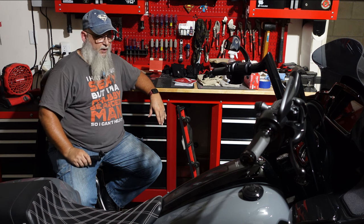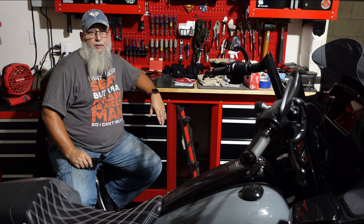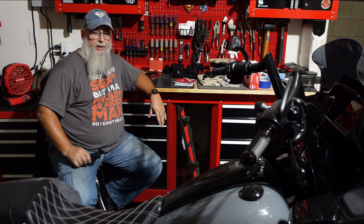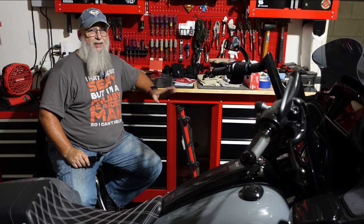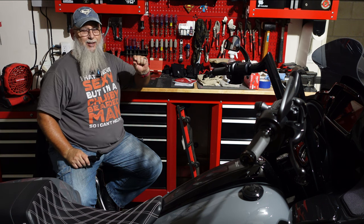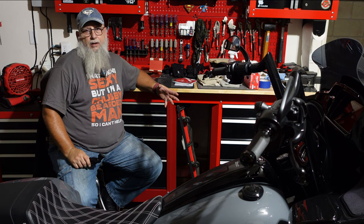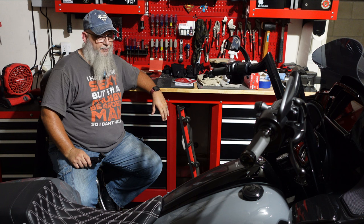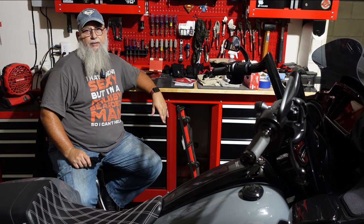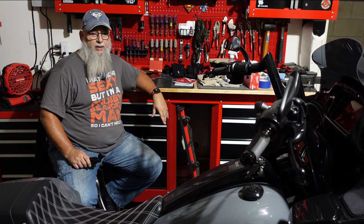Quick follow-up after the full ride: I tried it probably eight, nine, ten times and hit neutral every single time. The Thrashin inner shift arm definitely does the trick — a lot less resistance on the peg, found it every single time. I was really close on my adjustment; I think I need to go up just a touch more, but my measuring method worked. All in all, great product — aircraft grade aluminum, made in the USA, looks cool, matches all their other stuff. Good job Thrashin. Hope this helps — like, subscribe, and we'll see you on the next one.